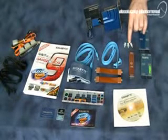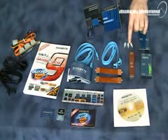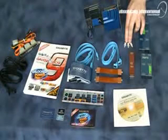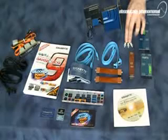The motherboard is an ATX XL form factor, which means this motherboard is longer than a regular one. These are to be used in the bottom 3 holes of the motherboard to reduce the possibility of flexing, cracking or bending the motherboard.